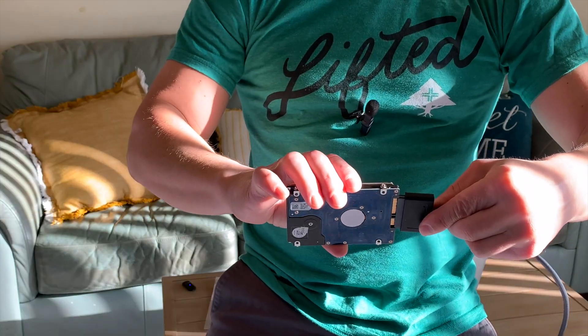Then you're going to use this StarTech SATA to USB connector and it's going to connect this hard drive to your other laptop or computer device. You're going to be able to take the files off and put them wherever you want, including on another hard drive, or you can just access them and save this hard drive. All we're going to do is hook this end right here, just like this.